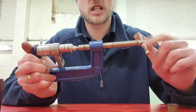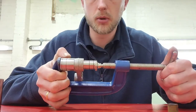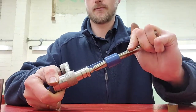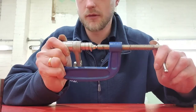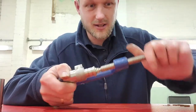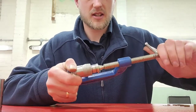You don't need much force - you don't need a spanner on the end for leverage. If it's not lined up properly it's going to push against that socket and not actually come out. Just give it a good twist. If it's a bit tight and a bit rusty it's just going to take some force to come out, but now it's sort of broken the seal it is coming. If it is too tight, you can use a spanner just to add a little bit of extra leverage.